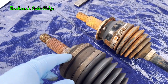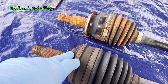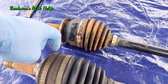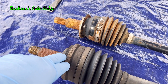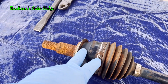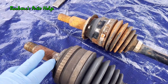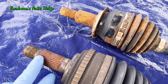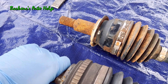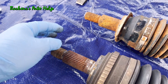Out here you'll notice differences between the two CV axles as well. One has what's called a trigger wheel — most vehicles nowadays have four wheel ABS, and an ABS wheel speed sensor sits near this end of the CV axle, reading how fast it's spinning and sending a signal to the ABS module. On both axles, you have a splined stub portion that goes into the wheel hub, which is connected to the wheel — the splines grip and rotate the hub, rotating the wheel. On the end, there's a threaded portion where an axle nut goes to fix the axle to the hub.